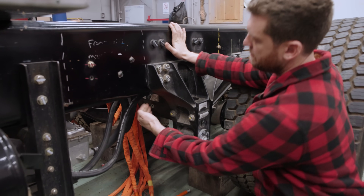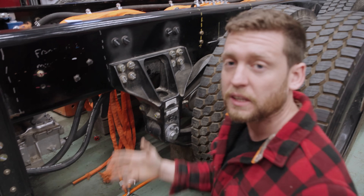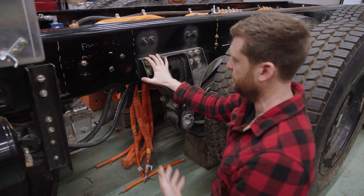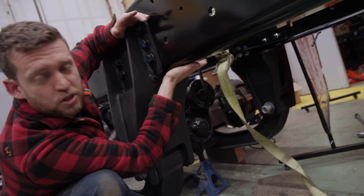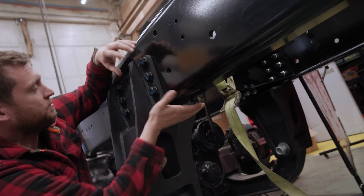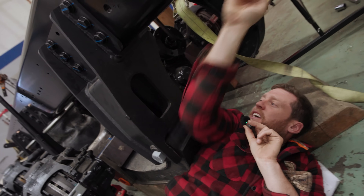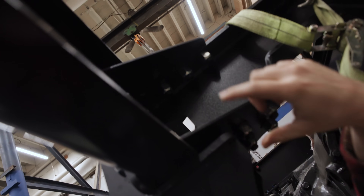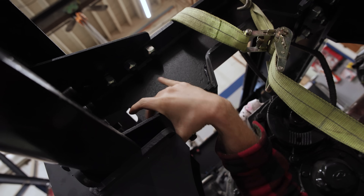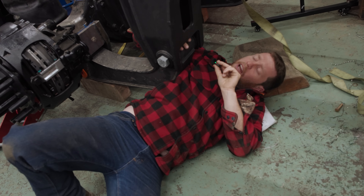Another little difference — if you have a look under here, there's no plate on the back side, so these bolts are really what are holding your suspension system on. That works — I've had log bunks attached to bolts. It's really not a concern as long as your bolts are torqued up. However, on the New Way AAD suspension, it has a cradle — this suspension here is cradling and holding that frame rail up. You have more bolts through the side, and then underneath there are bolts that attach through this crossmember. It bolts through the frame rail, it cradles it, and bolts right through — it gives you a lot more reinforcement. Nice mud clearing too — huge holes to get all the mud out.